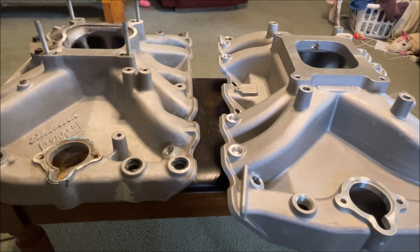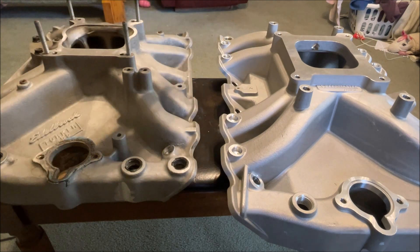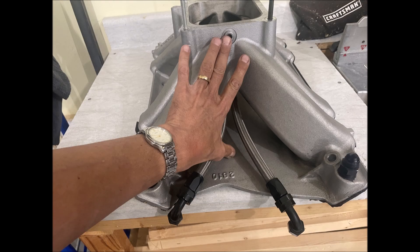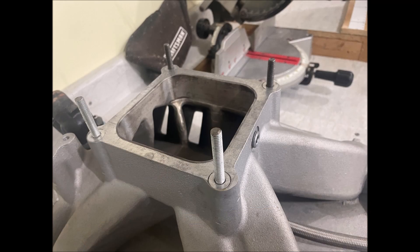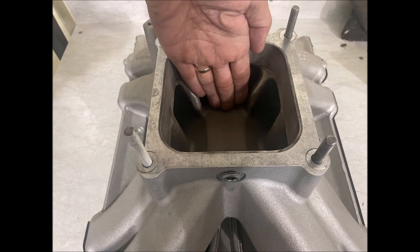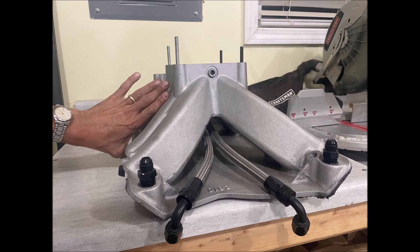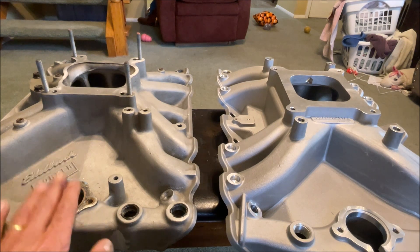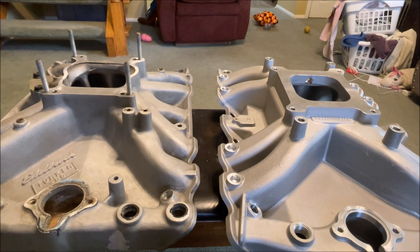The only other offerings in the single-plane space: the Victor intake is about 10 inches tall — massive, with hood clearance problems, built for maximum effort, not street driving, like a solid roller cam for a 12 or 13-to-one engine. Other choices are the Offenhauser, and there's a Porto Sonic and Supersonic, but they're hard to get — they don't make a lot of intakes and they're around $700-$750 with months-long availability waits. So right now there's not really a great single-plane street-strip intake offering unless you find a Torquer on Facebook Marketplace or eBay.